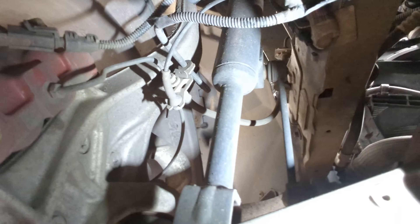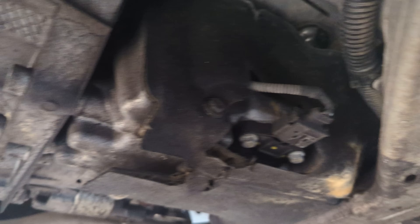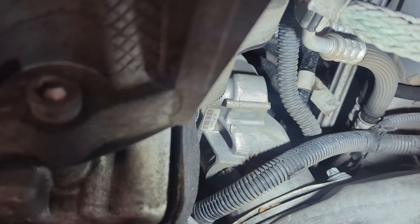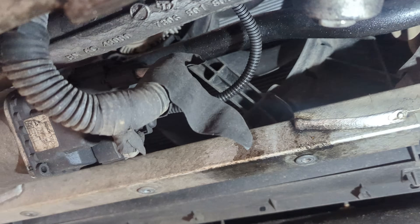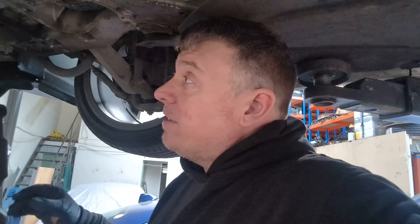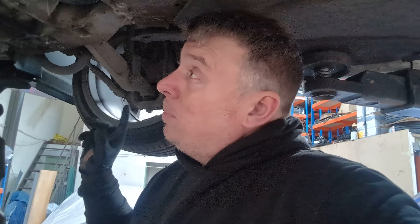All the brake pipes and brake hoses look okay. Let's have a look at the underside of the engine. From what I can tell immediately, there are no oil leaks coming from the engine — that all looks lovely and clean. No signs of any coolant leaks. All the engine mounts appear to be in good order. No signs of any cracking on any pipework and no signs of any rust. There is a small oil leak here which looks like it's coming from the intake manifold, so that's probably going to want an oil separator. The oil separator is on the engine and gets clogged up — there's a filter in there that needs to be done with the cam belt change normally. As it's leaking, I would assume it probably hasn't had one, hence it's pushing oil through the intake system. That's one problem that needs to get rectified — you've got to take the auxiliary belt off to change it.